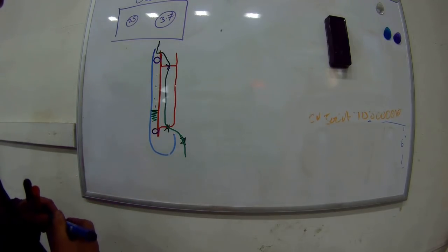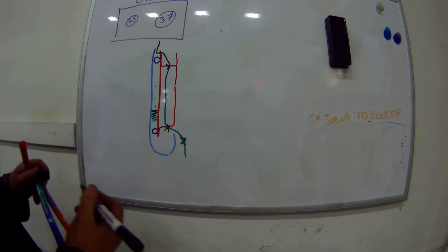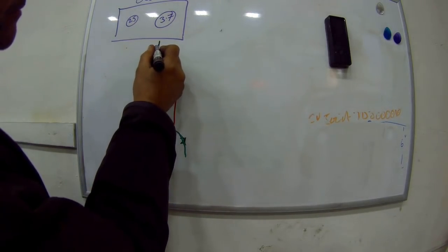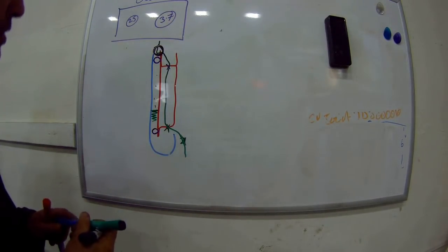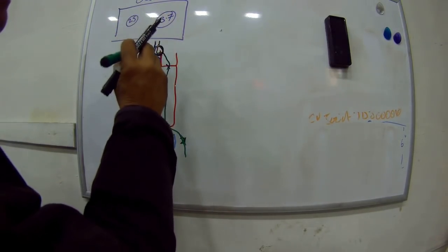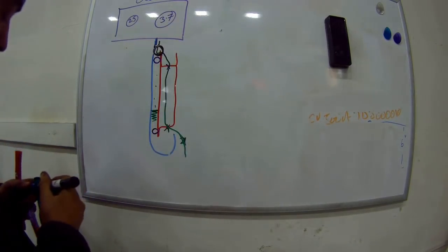It's sad, really. How to stop it? Well, what I try to do, if I've got a new door, is instead of putting the mastic here, I run around with a caulking gun, and I put a great big bead of mastic here. So if this is the extension of the door, I don't want to destroy that drawing because it's very important. If you've got the door skin coming up here, if you put mastic on here, then the water...